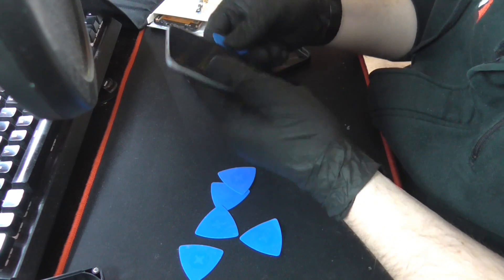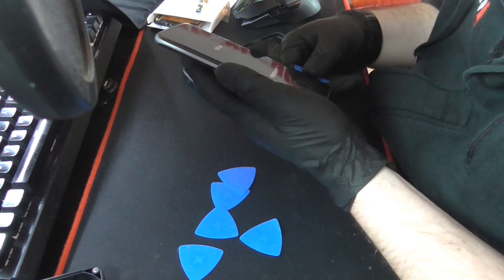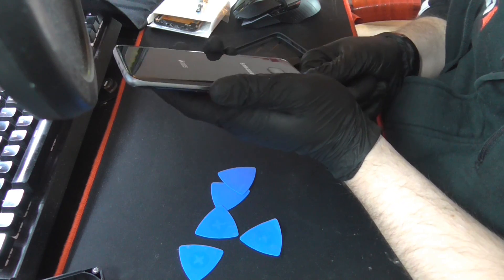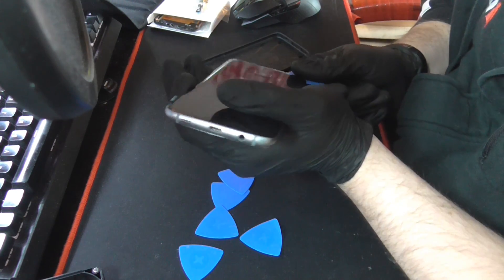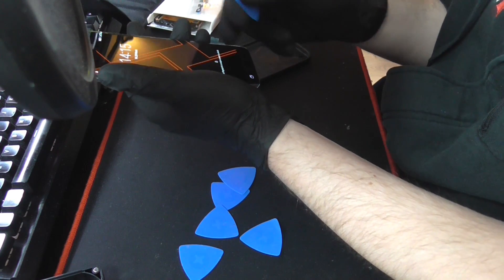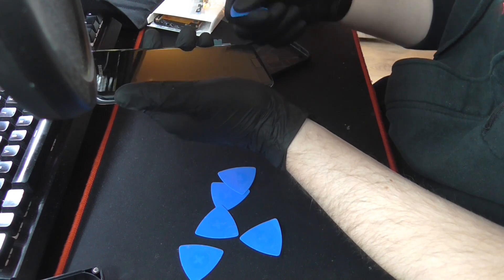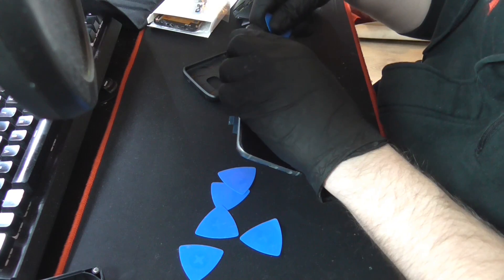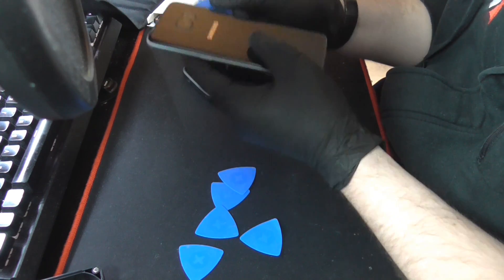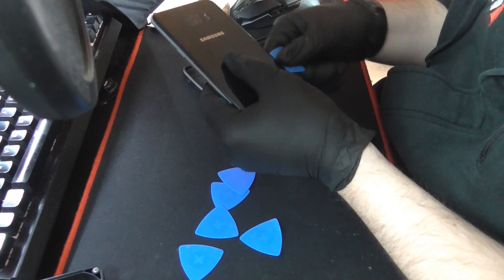I've been following the iFixit teardown, and in my defence of wrecking one of the touch buttons — I was paying attention when she said be careful of those cables under there. What I didn't realise is you have to cut at a certain depth, otherwise you'll catch the ribbon and tear it. That's the risk you take when you try and do things yourself. Luckily it wasn't too expensive — it cost me a few more days where my phone was working but not finished.